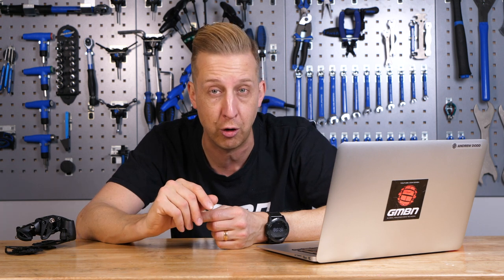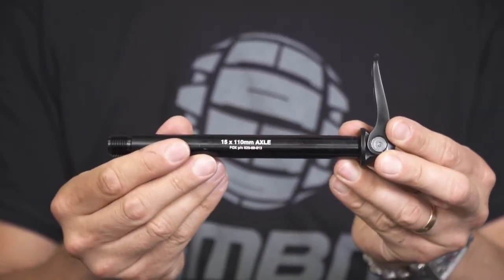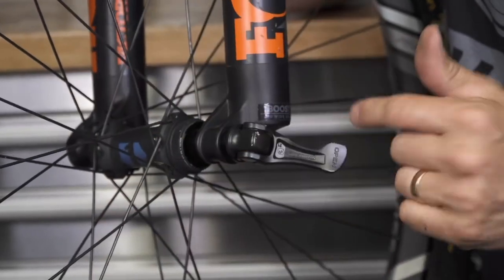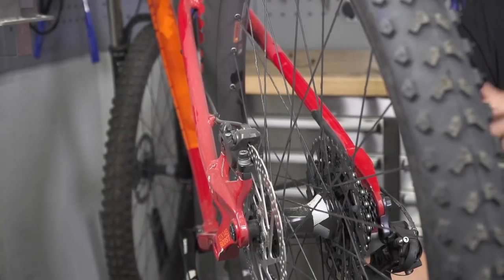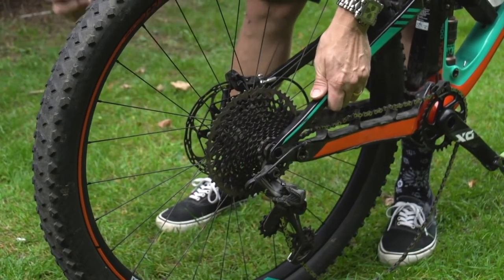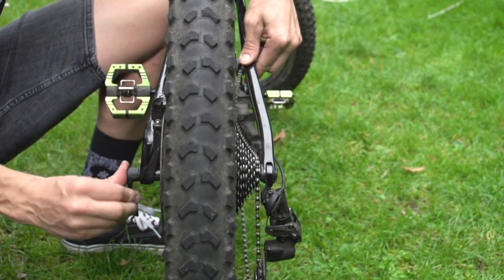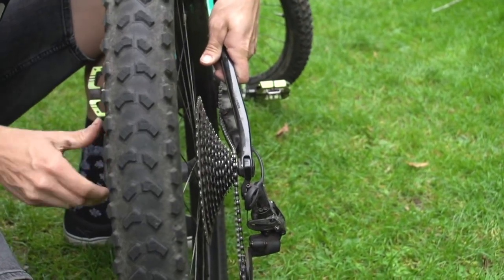That is universally known as the best way, and you even see this taken across onto rigid forks, road bikes, and gravel bikes now. The system now is effectively like an oversized quick release — it screws into the fork itself and has a cam-operated lever, with some options that just have an Allen key head. Out back on a hardtail, the bike frame is a structure — the wheel simply sits in there and the quick release holds the wheel. It's not there to do anything with frame rigidity.